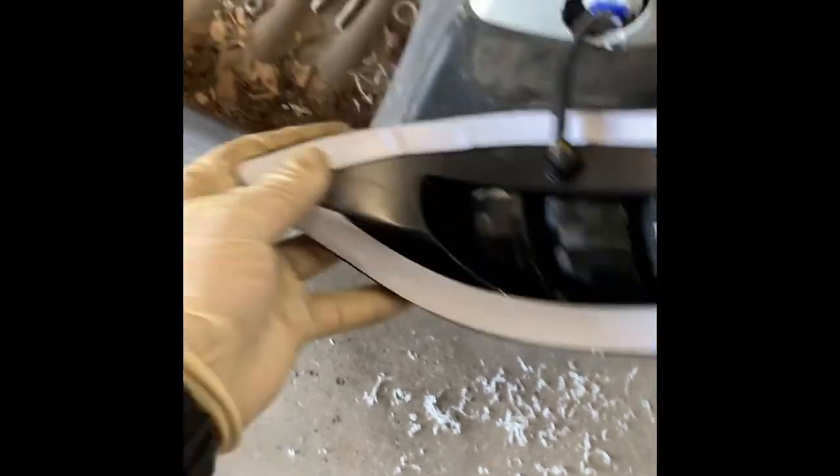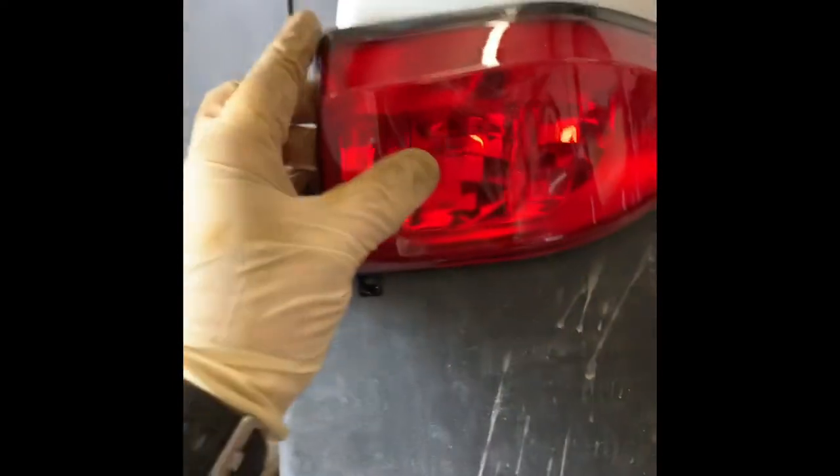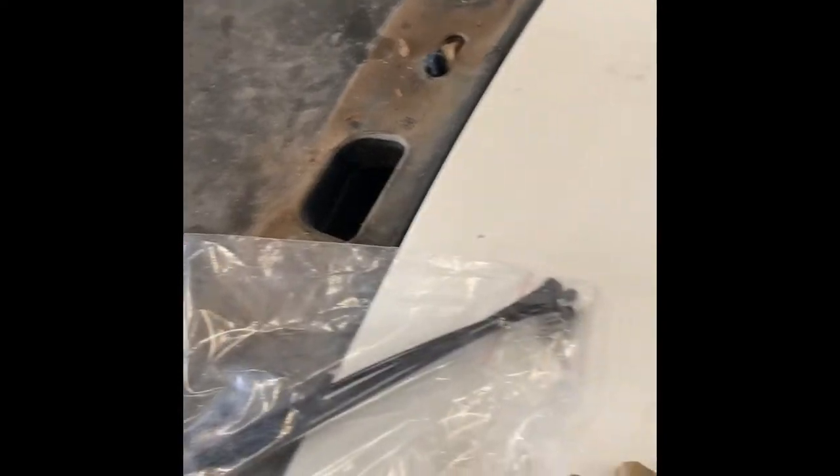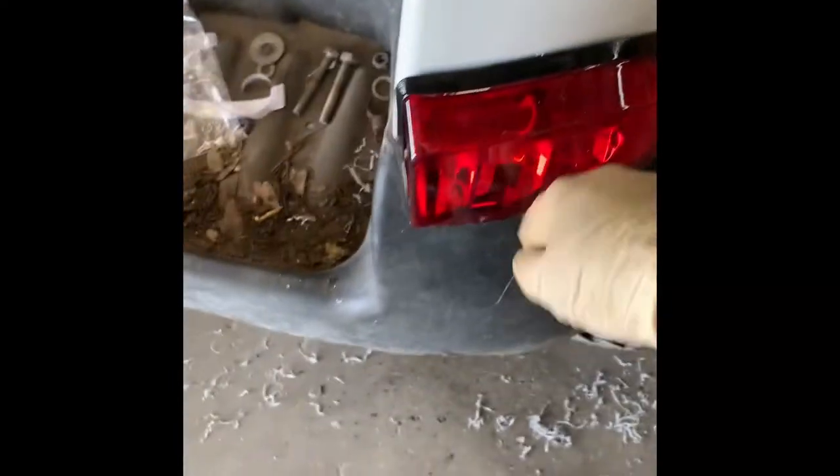I've fed my wire through and cut both holes on both sides. Now we're going to peel this plastic off so we can get to the adhesive tape and push it to the body. Now that we have the tape off, we're going to slide the light in — find your hole, push against the body, and then put your screws in, one down there and one right there. You are going to get a hardware pack with your light kit — it comes with instructions, zip ties, and your four screws. We'll use those screws to lock it down, then do the other side as well.